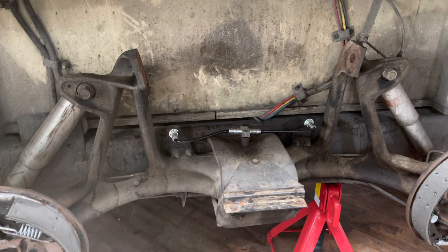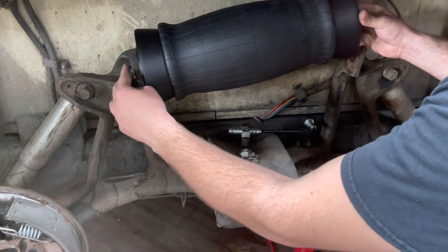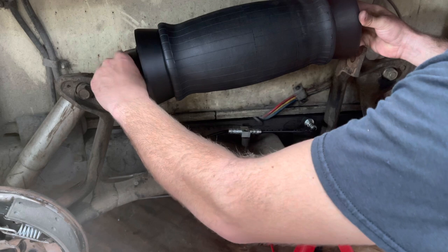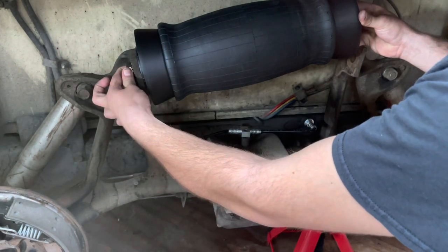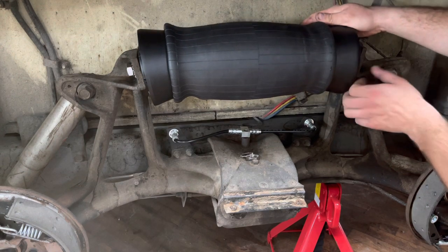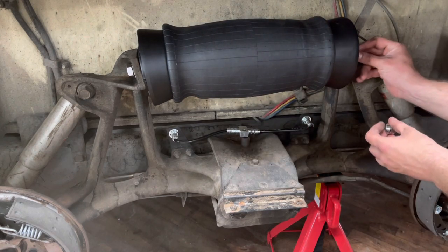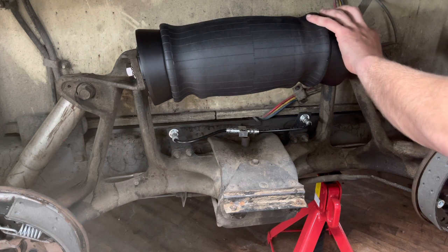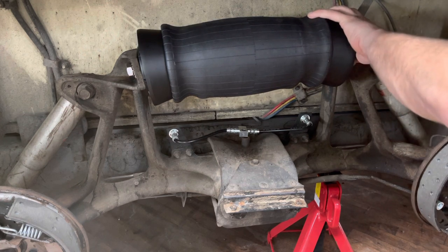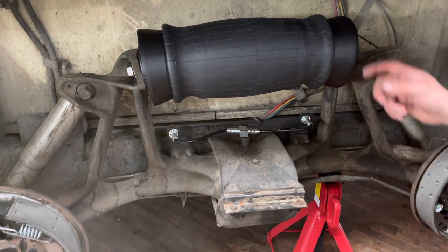Cinnabar Engineering gives you new stainless steel hardware, so put that in a handy spot. I like to start with the closed stud first — just insert that, put the lock washer, and then get the nut started. There's no direction on the nut or the washer; they go either way. Then you can fold this down and lift up the other arm to get it to seat and put on that one as well. If you're not strong enough to lift the arm by hand, you can put a jack underneath the backing plate on the brakes. Since you're not jacking up the weight of the vehicle, it works just fine to lift the bogey arm and get the stud to pop out.